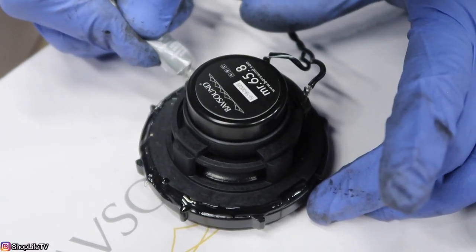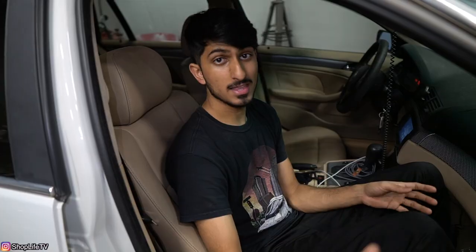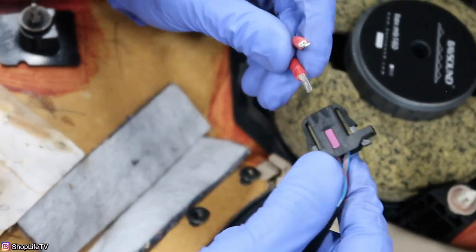The one thing that bugs me is the glue part. I'm not a big fan of glue in a car, especially in a hotter climate — that glue is eventually going to melt. The other concern I had was the speakers in the front and back that connect without an adapter plug; they're just two terminals you slide into the stock plug. I really wish they had found a way to provide an actual adapter so the pins aren't just sitting in there. A quick fix would be to cut off the plug from your stock speakers and solder them onto the current speakers.